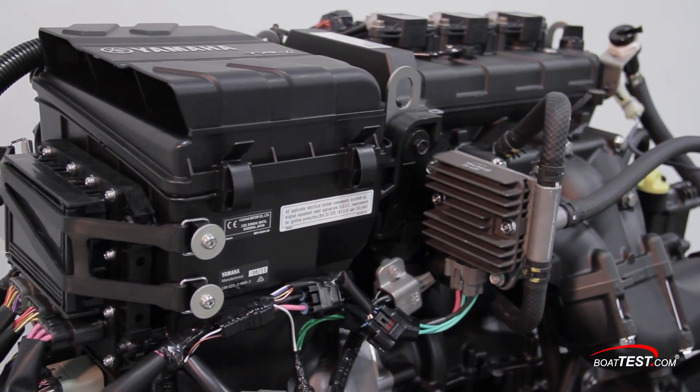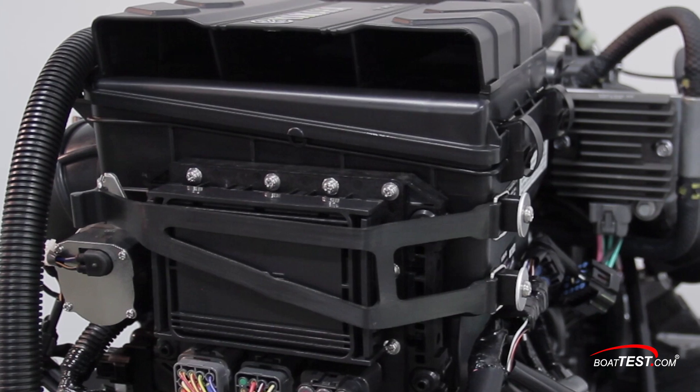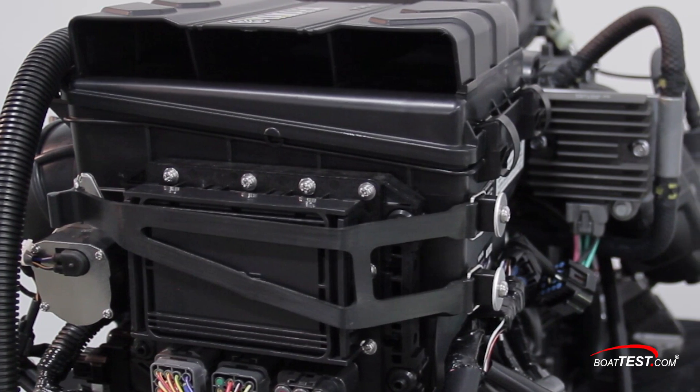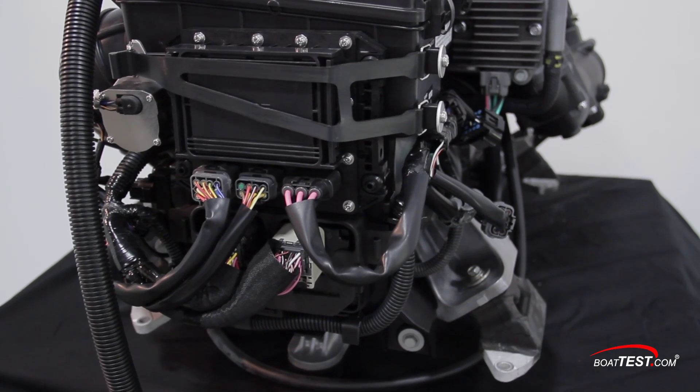The engine's compact profile comes from the fact that Yamaha is now integrating a lot of the components into the engine — the air cleaner in the front, the oil filter in the back, and overall its three-cylinder design. Just below the air filter box on the front of the motor is the engine's electronic control unit, or ECU, which is held in place with this bungee-style strap. Having it attached to the motor is another upgrade designed to make the engine fit into a smaller envelope.